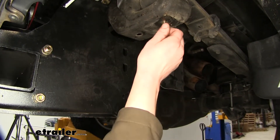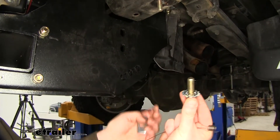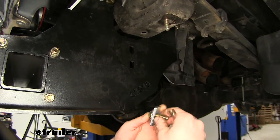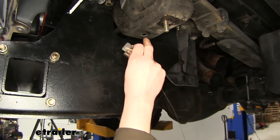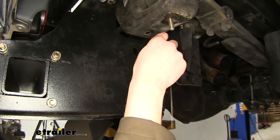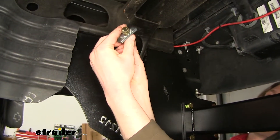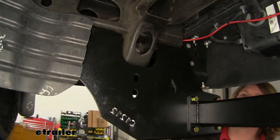Next, we're going to need to fish some hardware into our spring perch. I've already got one fished in. What you're seeing sticking out there is a 7/16th bolt with a star washer on it, followed by a 1x2 spacer plate. Now if you had your L bracket here, there would likely already be one of these bolts with this exact same combination sticking down in this hole. If not, and you're installing this, you're going to need one in each hole here. So we're going to use the included coiled wire, push it up through that hole and come out the back side of the spring perch. On the back, we're going to thread on our pre-assembled assembly, then put it inside the spring perch and use the coiled wire to pull it down through the hole.